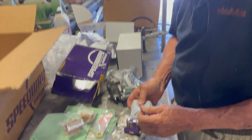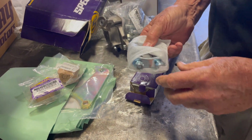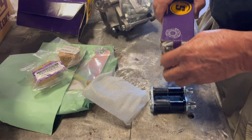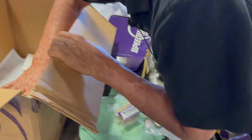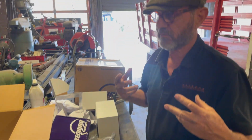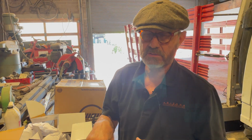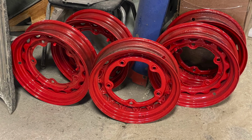Okay, these are the rear end. This is for the spring, rear spring, I'm guessing. Okay. Also from Speedway. Sure. They got the other one there. Looks like quality stuff. Yeah, remember we're going to be putting a whole new rear end, a whole new spring, all new brakes. We're going to do some adapters on this particular car to go back to the 38 style wheel, which is an artillery wheel. And we're kind of committed to that.